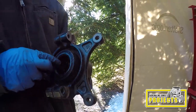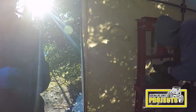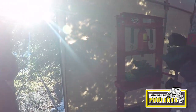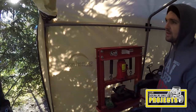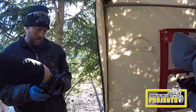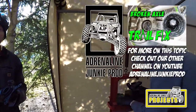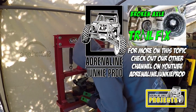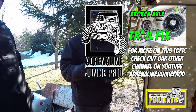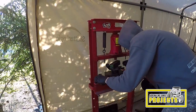On a double roller wheel bearing like that, the axle actually pinches the inners together. It removes that play. You need the tension to keep the bearing together. That's why you have to leave the inner piece of the axle in, even if you break an axle. You can't just pull it all out, or the wheel bearing collapses. So if you hit this inner with a punch, pop that inner out first. If you break your inner joint on your CV, you have to break the outer, or carry a spare whole axle. But you want to leave the shaft. It usually breaks off at the wheel, right? So just take the remaining piece and yank it out and keep going.